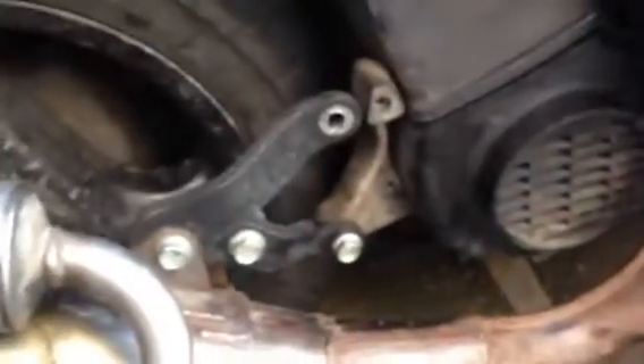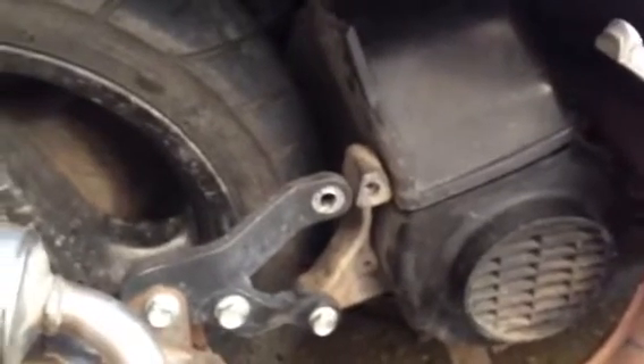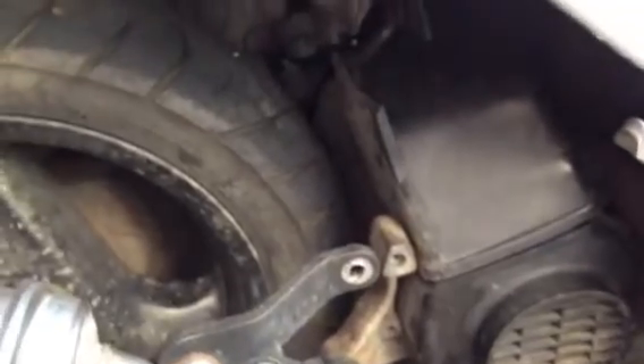And my whole favourite - I'll see if I have a video on this one - the white one. Yeah, he killed it. Basically this one is a non-water-cooled, so it's air-cooled. And he's knackered the engine seals on this one - crank seals, engine seals, whatever you want to call them. To be honest with you, everything I touched on this wanted to snap and break. So sometimes, easy to say, that engine's dead.